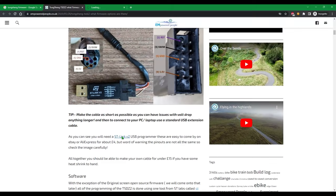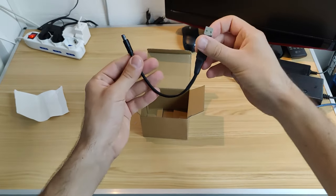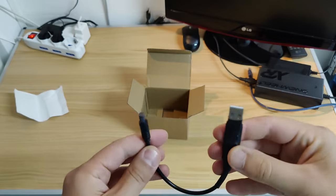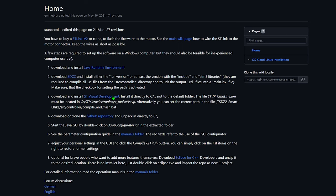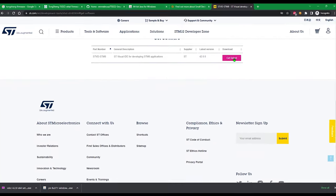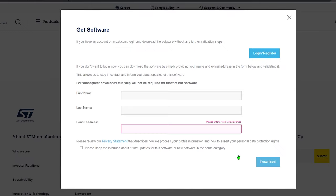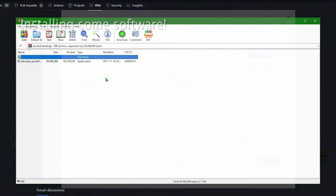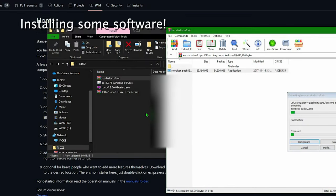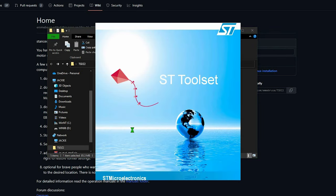For the installation of the OSF, we will need the same device that we saw in the last video: the ST-Link V2 STM8. You can either buy it or do it yourself. You must install it on your Windows computer, along with the software ST Visual Development. You will need an email address to receive the download link directly. After finishing the extraction, continue with the following steps.